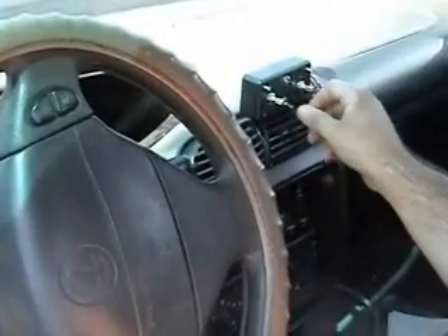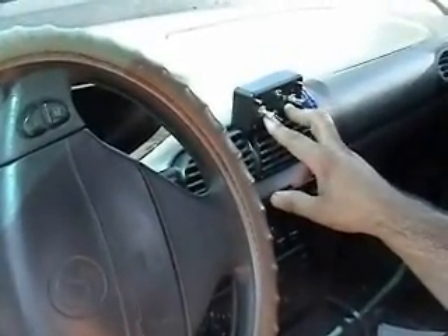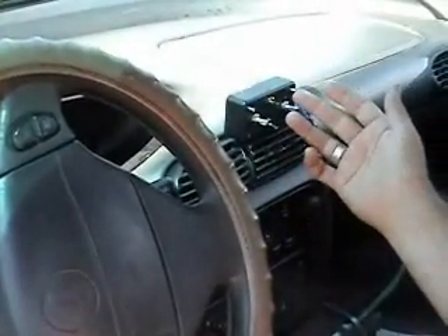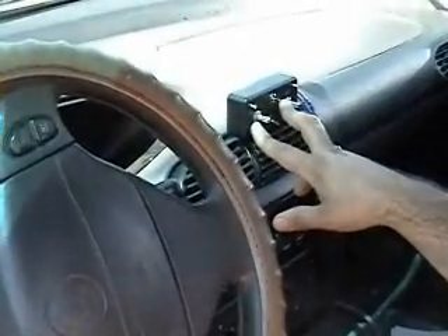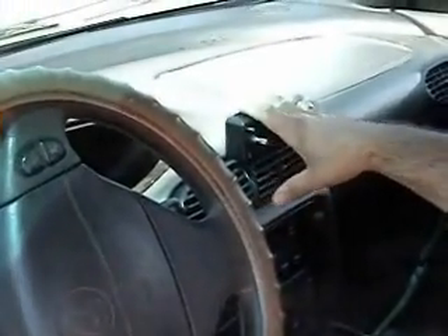By design it's going to tell the ECU it's too lean and to send more gas. We're trying to avoid that by taking away some of the voltage through resistors and a potentiometer. Right now the resistors are not resisting any of the electricity coming through, so when I flick the switch it's basically leaning the car out so much it stalls the engine. I'm going to have to redo the resistors on the inside — put some stronger ones that can withstand 12 volts. So it's in operation, it's just not being used at the moment because of the resistors that need to be changed.